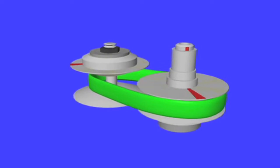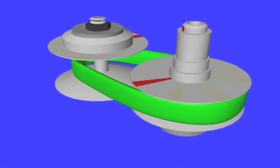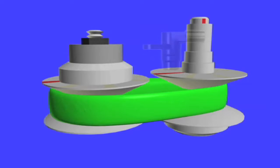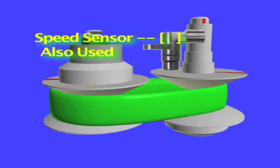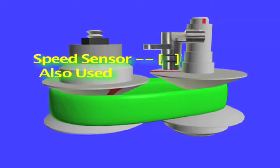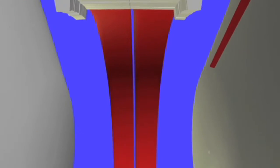Keep in mind that CVTs work by pushing on the belt, and the right tension on it is of absolute importance. How does the TCM know the CVT belt tension? Well, very easy, by monitoring the variator pressure sensor, and comparing this value to a pre-programmed lookup table. In other words, there's complete computer control over the hydraulic pressure, and hence, over the CVT belt to pulley clamping force.